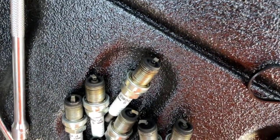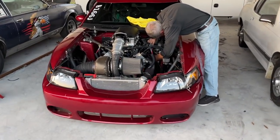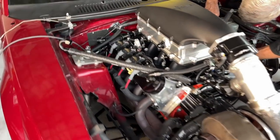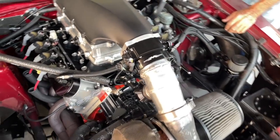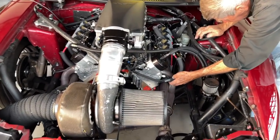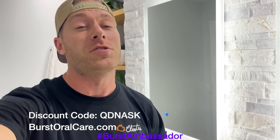I know you guys are going to rip on me, but these are some fuel-soaked plugs if I've ever seen them. We're wrapping up Dr. Pepper — getting the fresh plugs back in after turning it over a couple times to make sure we get all the fuel out of the cylinders. Next time, Sam and I were talking — anytime this car sits, we're going to turn it over by hand a couple times to make sure it doesn't lock up, because if I wouldn't have pulled this intake today, I would have gone to start it and it would have thrown a rod. Blows my mind that for something we've worked on so long, something like that could go wrong so easily.